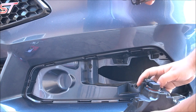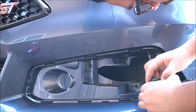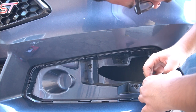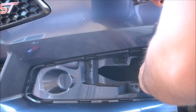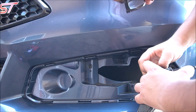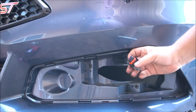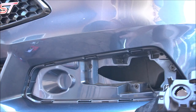You're just going to pull off these two clips right here on the side. These two on the side should come out — just like that. Then just twist your fog light to the side, and boom.